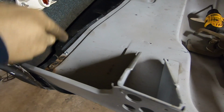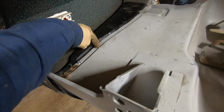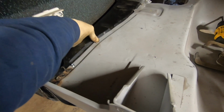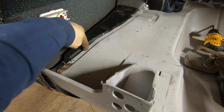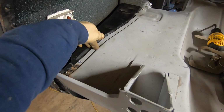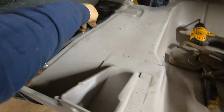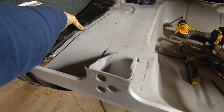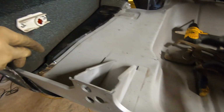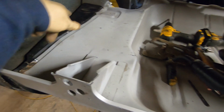So we're just going to alternate. We'll keep flipping. If these are nice and tight together, I'll keep going. If there's a small gap or void, I'll run a screw in and hold that tight. Even if there isn't, once you get so far away, it's good to either stop and let all this cool down a bit, because you will get some warpage, or run a couple more screws. Even if it's tight now, as you weld, the warpage will make a gap. So we're just going to alternate up through there, keep drilling our holes, and get this side.